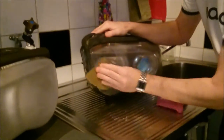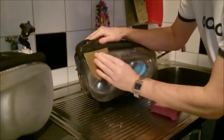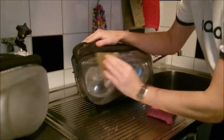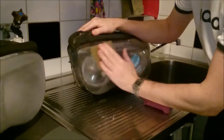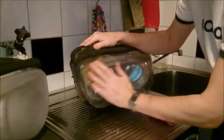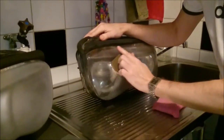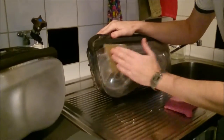Down here we are starting to work our way down. I'll do just one small area and see if I can break a hole in the clear coat. Also, because I don't want to mask it off too much, I will try to make as straight an edge as possible at the top on the indicator, because if you have too much of an edge you will clearly see it when you put on the clear coat.